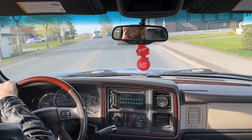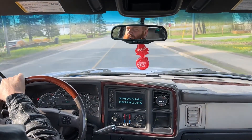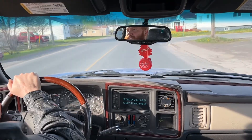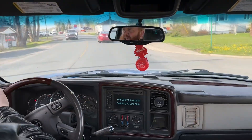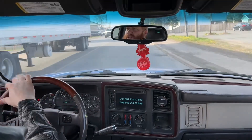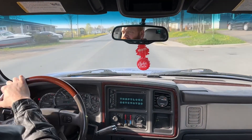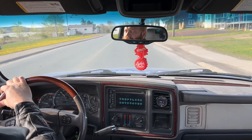As I mentioned, I did this tuning in gear, so basically just do the exact same thing in park — you don't have to put it in neutral. Park neutral is the same setting, so just do it in park. You don't have to chock the wheels because you're in park. Get it as cold as you can, let it warm up on its own, don't mess with the controls on the dash, don't go messing with air conditioning — just leave it alone, let it do its thing. When it gets up to operating temperature, let it get a few hundred hits at that cell. Hit that little C for counts, and when it gets to three, four, five hundred counts — take that data, plug it into your tune. At some point you might only have to do it once; it might be perfectly fine. You might have to do it twice — I'll probably do it two or three times because I'm a little particular. But it will improve drastically and quickly.